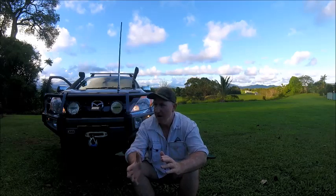I'll keep harping on about getting everyone out of the way throughout this clip. When you see me winching a little bit later, Roz will probably be filming, and I'll make sure she's way out of the way of that winch cable — at least one and a half times the length of the winch cable. So if something does go wrong, she can't be hit by anything.